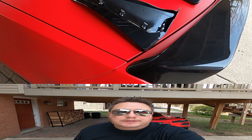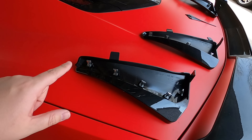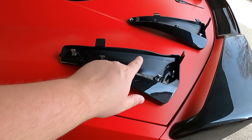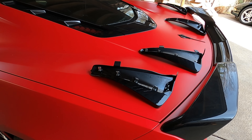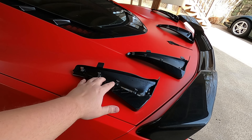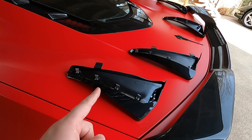So, a little bit of a closer look at these things, guys. We obviously have one bolt hole here at the bottom - that is likely to be a 7mm screw holding it up underneath the car. The rear ones actually have five metal clips that are going to hold this thing to the body of the car. Five clips and one 7mm bolt. The front ones are basically the same - one 7mm bolt, but they have four metal clips holding them on instead of five. Nothing earth-shattering, nothing that's going to require any kind of doctorate degree here today. But at the same time, I do want to show these things off because I think they're going to look awesome and they're definitely going to be functional.